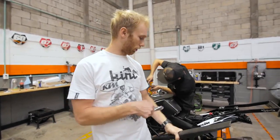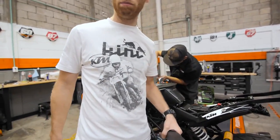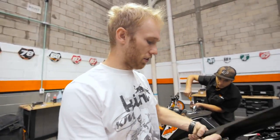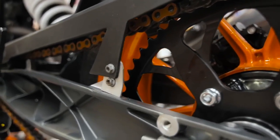Let's do a simple trick when mounting the chain guard — I just cut this away. And then I have a little spacer because the sprocket is bigger, so the chain guard needs to go higher. This is a simple trick that I do.